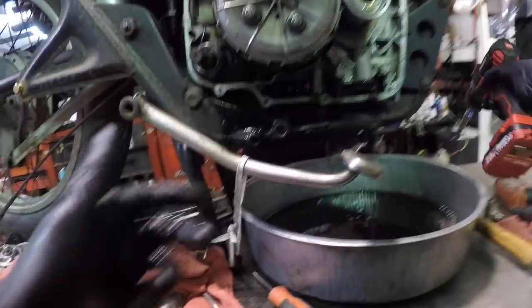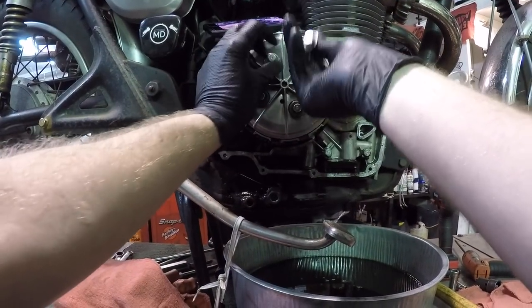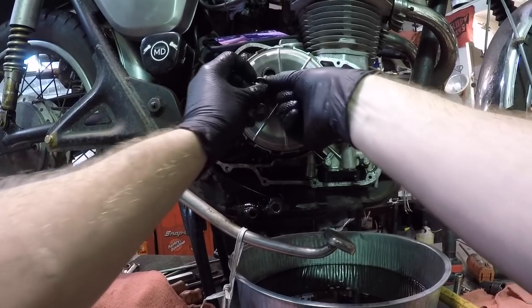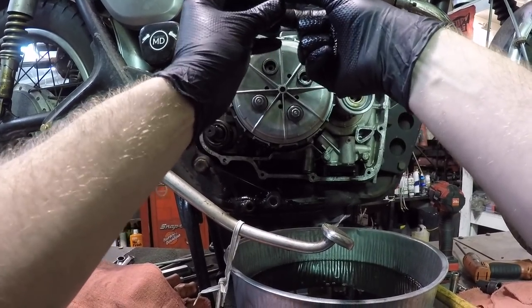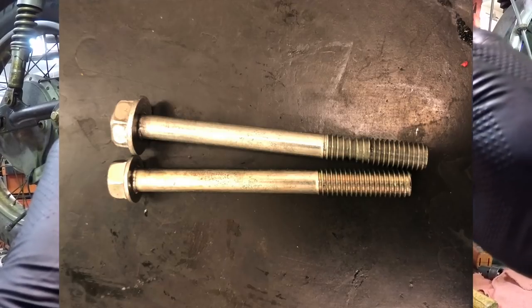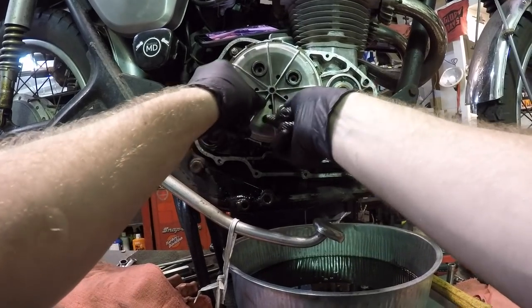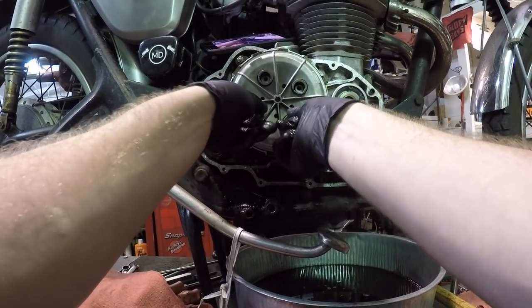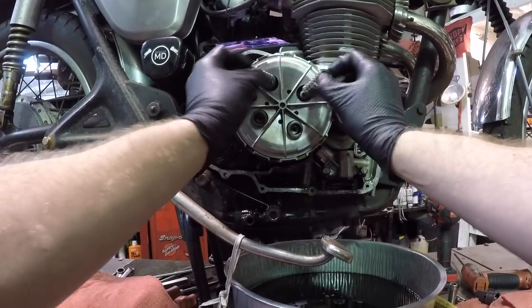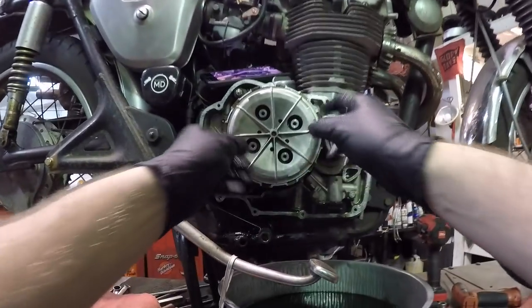Now they're all the way loose. I can kind of smell the clutch right now. It does smell kind of burnt. Probably the factory original bolts. I'm not going to change them out. You can if you want to. Really worried about seeing some crazy stretching going on in the bolt, like someone over tightened them. And I think I'm the only person who's actually gone in this clutch before, so I'm gonna reuse them. So here's the springs, take these out, 1, 2, 3, 4, and my washers are still in there.